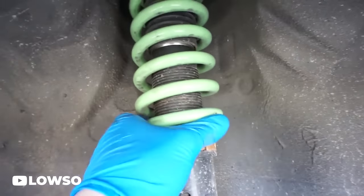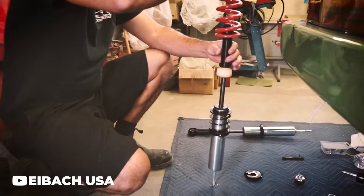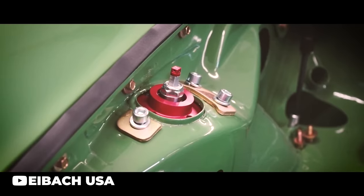The first thing when it comes to dialing your suspension — but more importantly, when you're trying to slam it on the pavement — is not taking the coilover out of the car to adjust it. This is what commonly happens with adjusting ride height, because let's be real: who wants to take an entire coilover out to lower it and have proper techniques and processes? Have you gone to college? Procrastination is the key to success. But in all honesty, you should actually take them out to use the lower threaded body of the coilover to adjust the height of the car. Using much else isn't usually a good idea. Threaded lower bodies won't come on all coilover options though, so keep that in mind, which kind of bleeds into numero two.